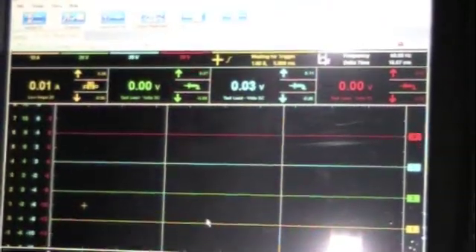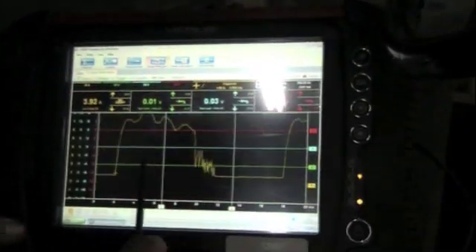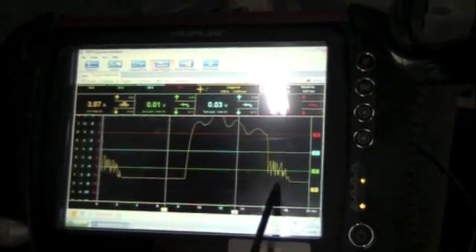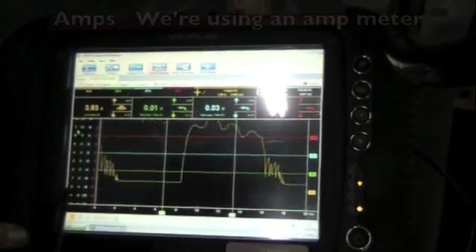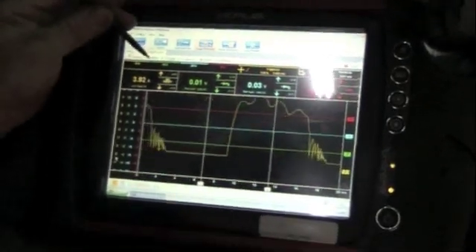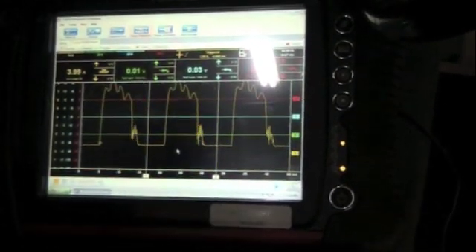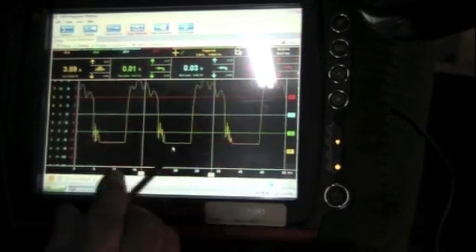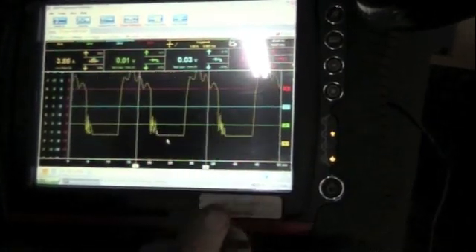I'm going to change my sweep to 50 milliseconds — this gives you the ability to look at it a little differently. Now when I turn the key on, you can see there are like three different places there. When we start this vehicle, you can see the lab scope. Every time it goes down, remember you're dropping down to zero. We're on the yellow trace reading the yellow numbers — zero volts, then it goes up over seven or eight. Now I want to change the sweep while we're live to 50 milliseconds. It just compresses it, so you can see the fuel pump running and stopping. Now when you shut it off, if you stop when it's down here, it's not going to restart for you.